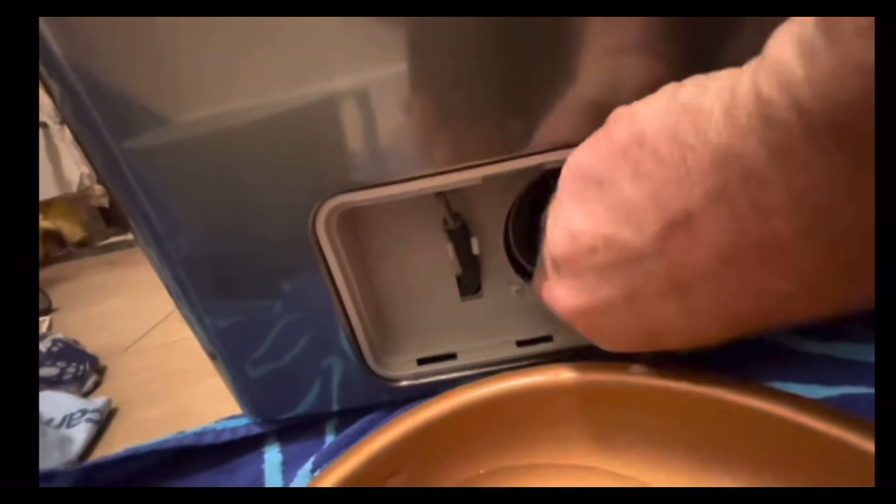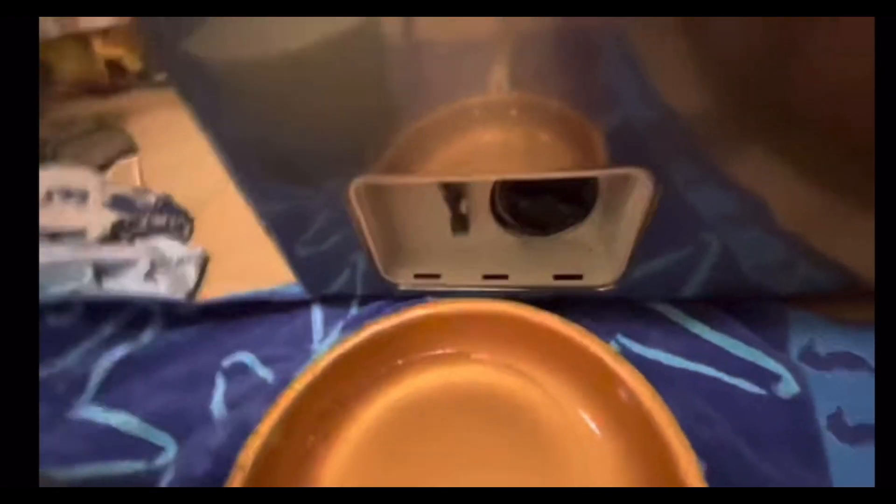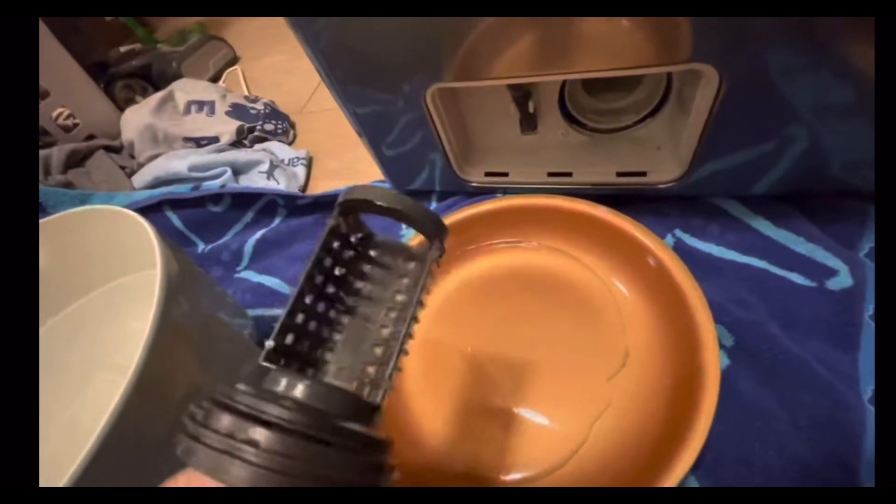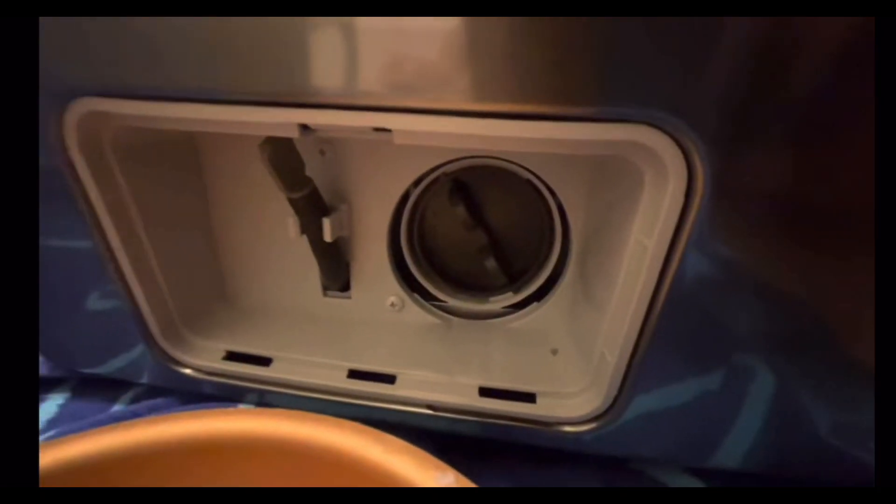This kind of loader is very nice that the drain is in the front. Our last LG washer, we actually had to open up the back of the unit and it was really a pain in the neck. So let's take out our filter — and there it is. Now this filter is clean because I've cleaned it recently. Kind of clean it out, make sure it's all nice and clean here. Then the basket's going to go in just like this — turn it a couple of revolutions. When it's done turning, you can feel it — it's a pretty firm stop when it's ready to go.